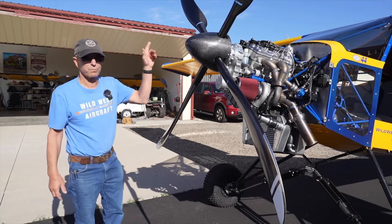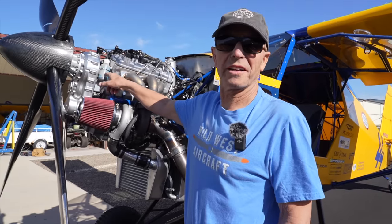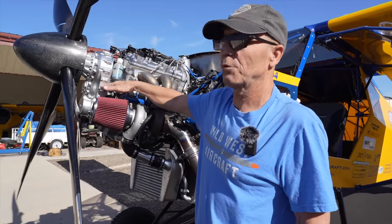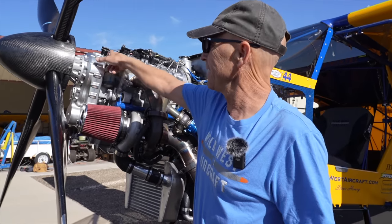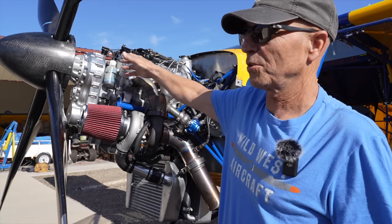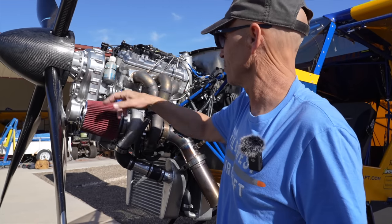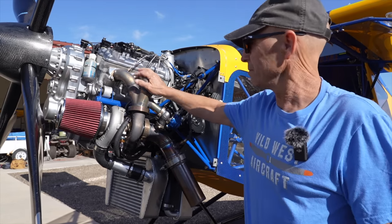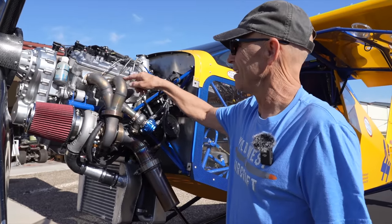This hokey-looking little bottle here — we're still kind of working on finding exactly what's the right level of oil in the gearbox so it's venting a little bit. It doesn't take much oil to make a big mess, so whatever does vent I'm catching in this little bottle.